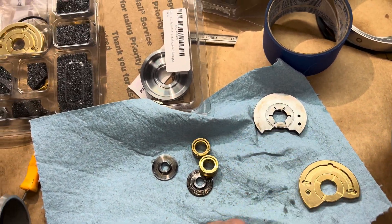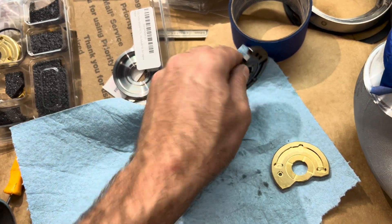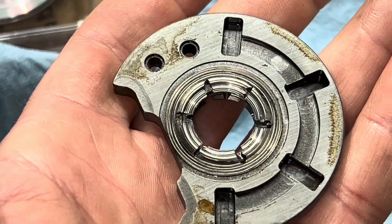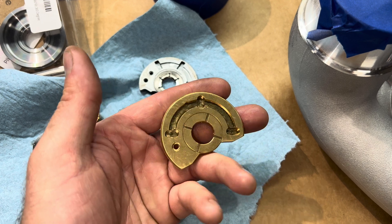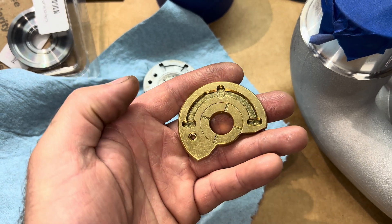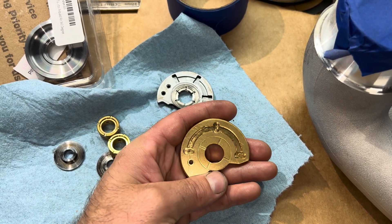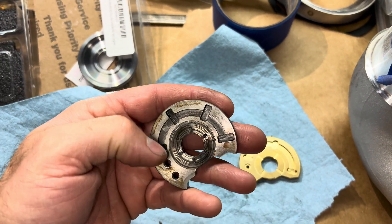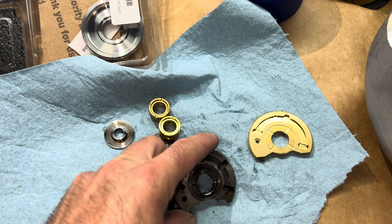This turbo — when they sell this, it's just like a remake of an S300. This is an S372. What happened with this one: this piece being steel just causes a bunch of problems. It heats up really bad. What you really need is a copper or brass thrust bearing that's going to dissipate the heat properly, which is clearly proven because this is used in OEM turbos, in Holset turbos, all the way up to semi trucks. That's why they don't have problems like this. What they try to do here is use this bearing as an upgrade — it's got multiple oil ports, which is good — but the material just causes a bunch of problems because it overheats.